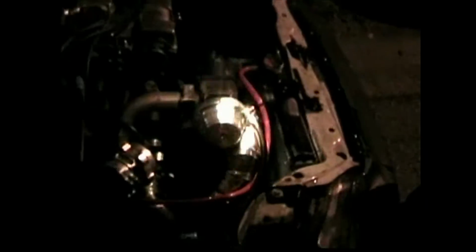And we're back. We found out what the deal was. If you can see right here, Bud, get the light going on it. Blew my upper radiator hose apart. You can see I have this crazy manifold so I can run air conditioning. It's the Love Fab Sidewinder. And I had to do this crazy upper radiator hose. But can you get the light on the radiator hose? Yeah, it's really crazy. I had to piece it together with steel tubing and different radiator hoses, and it looks like we blew it apart. And that's probably because I have a blown head gasket, and when we're going into boost, we're pressurizing the coolant system, so the excess pressure in the coolant system blew the hose apart, and in the process, we probably cooked the head too.